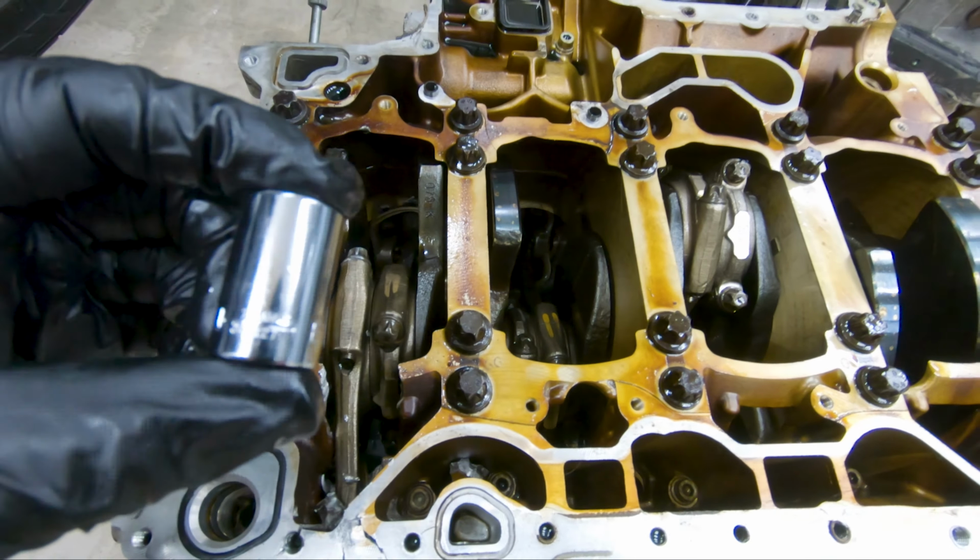And when I first saw this initially from the outside, I knew this was damaged. When I removed the oil cooler, that's when I noticed this was damaged. But I thought this was savable, but it wasn't until I removed the oil pan that here, which is where cylinder one is, where that rod definitely broke off this piece right here. So there was definitely a lot of shrapnel within that oil pan. So that pretty much summarizes the whole damage done because of the hydrolock situation.